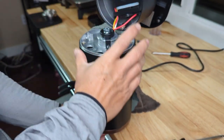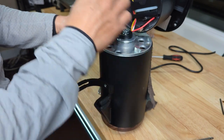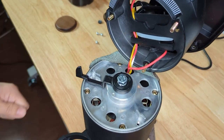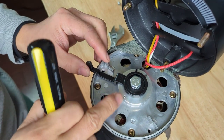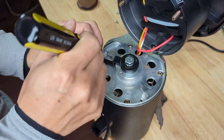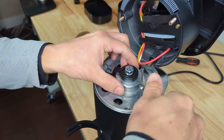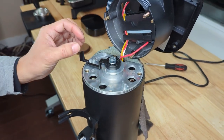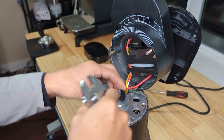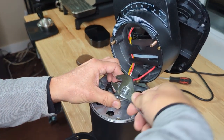When I hear the burrs touching, I loosen a little bit — that becomes the new zero point. Once you have your zero point, move the dial all the way to the left. But be careful: there's a position here with a screw that will block it, so don't go all the way to that end. Place the dial just before that point — that should be the lowest position. Let the dial move freely with your finger and also touch this piece, then screw it tight.